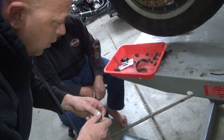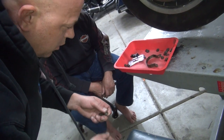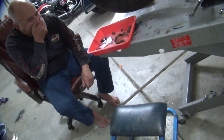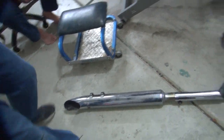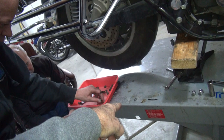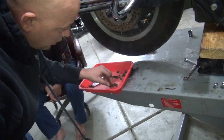Screaming Eagle turd stuff, huh? These old — $500 mouth with a 2-cent damn nut on it. Okay, put a little bit of oil on those threads. Put a lock washer on there — lock washer sitting right there. Put a little dab of oil on it. Put that freaking exhaust up before you throw it on there.